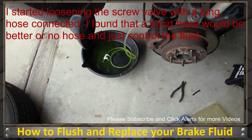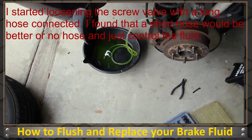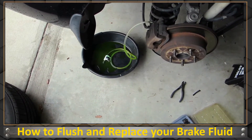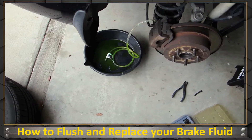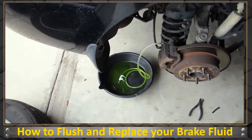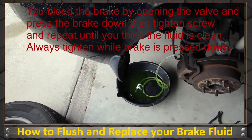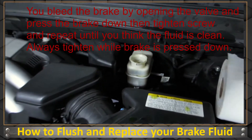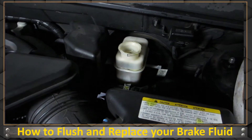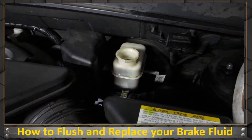I got quite a bit out of the system — it's still kind of green-tinted, but I really drained a lot. I did about 25 brake pedal presses: pushing the brake down and letting go repeatedly. Now I actually need help — somebody is going to have to push it down halfway and then I'll tighten the nut up so it has pressure in it. As you're pumping on the brake, make sure the master cylinder doesn't lose brake fluid. Constantly refill it as you pump — probably after every 10 brake pushes, start refilling.